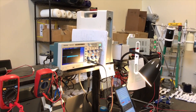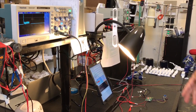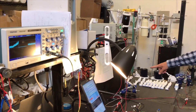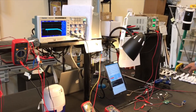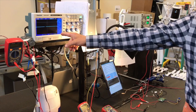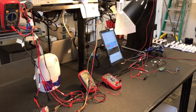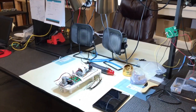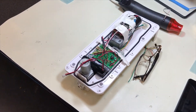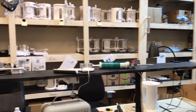This is an oscilloscope — originally this was to make sure we know how to stop the motors in a timely manner. The motor is going down: it starts going down, there's some current consumption, but whenever it reaches the end you see significant current consumption — we recognize that and it stops. When the fender is going up, it has a magnet, and if the magnet reaches the top sensor, the motor stops. But if it gets stuck, we recognize high current consumption and take it down and up, down and up, until it's released or can go all the way.